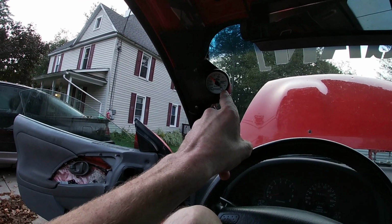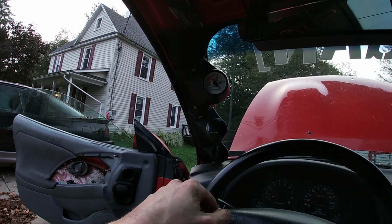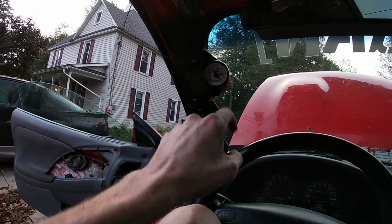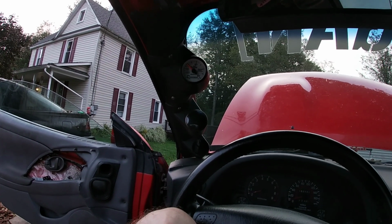So on my other turbo that I just blew last night, I would literally wrap the boost gauge around, like it goes to 30, right? It would go to 30 and then it would just keep going until it hit the stopper. It wouldn't stay there. It would go like this and then it'd start tapering back and then it'd go down to like 30 or 25 or something throughout the end of the pull. But obviously that's not smart to do, and you're overworking the turbo. But I don't know, for some reason I just didn't think it would shit the bed, but it did. I mean, I ran it like that for a long time, so it lasted longer than it probably should have.